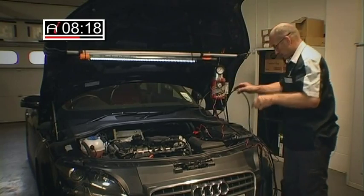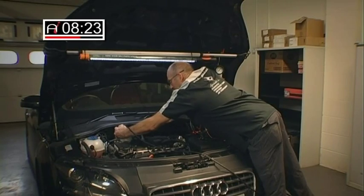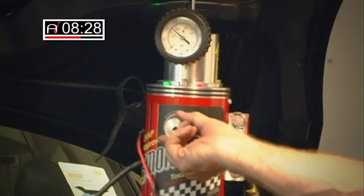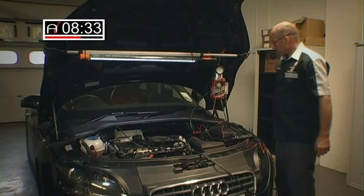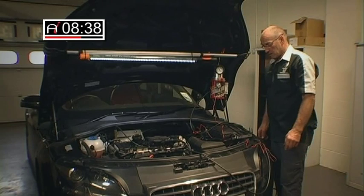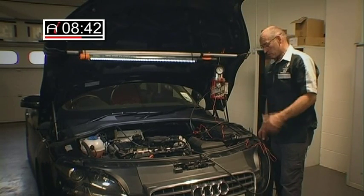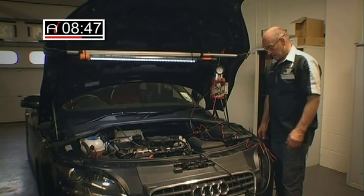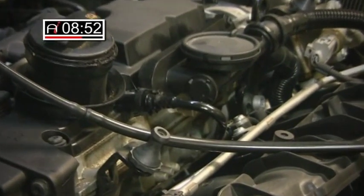So the manometer is the more accurate means of detecting very subtle flow changes. We'll come back to that manometer in a moment because we use it with great effect. So back in — heater's on. I want to fully charge the system. You will get a pressure drop because it's now filling up the cavity, which is a fairly large space. By the way, this vehicle is unknown — I've brought it from the commercial workshop purely as an opportunist moment to film. So the results of this are unknown. Interestingly, we do now have a problem.